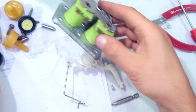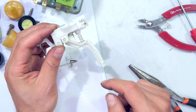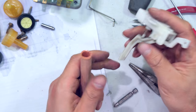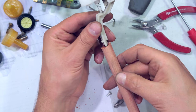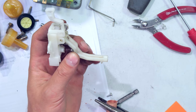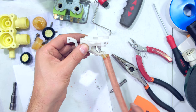The switch is functional but there was a spring here. I found some springs from an old solenoid — putting two together works. Also, the full lever length is not restored yet, so I need to extend it. I'm using a small pipe for this extension, cutting it to length. I squeeze the opening slightly to fit, shave off a little excess material, then glue it inside using cold glue. There's the new extended lever, ready to reinstall.